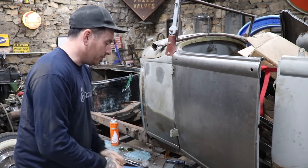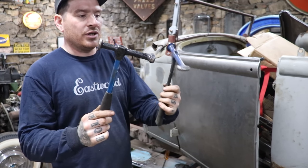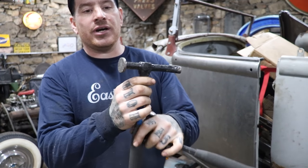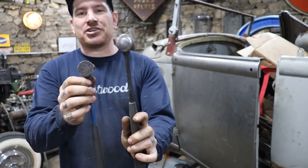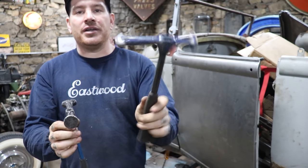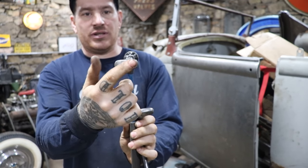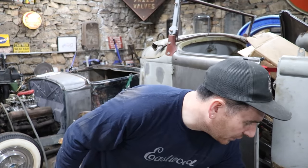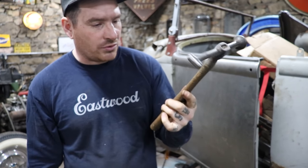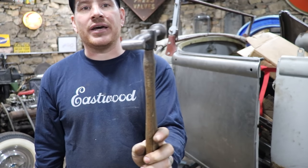For hammers, what I like to use when I'm hammering or hemming an edge, I have a couple different ones. These are old Eastwood body hammers with fiberglass handles - it's got a shrinking hammer on one end that I don't particularly like or use at all. So what I've done on this one hammer is actually shaped the face of it on the sander. This is a door skinning hammer that's meant for hemming over edges like this - as it comes standard it's a flat wide face, but I've made it more of a point so I can get into some tighter areas. And then I also have this old one, I think it's an old Craftsman from the fifties, with a real small round head on one end and a rounded edge on the other, which also helps with hammering and hemming those edges.